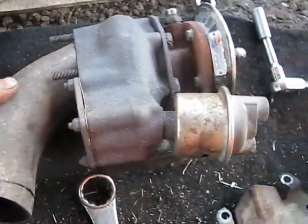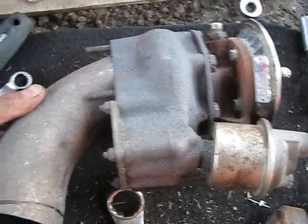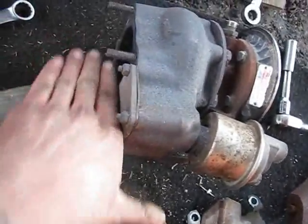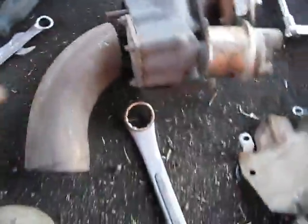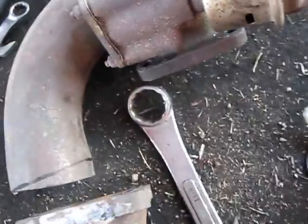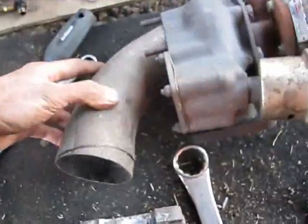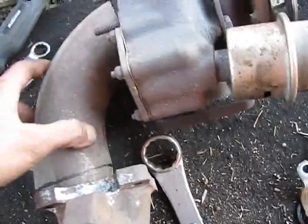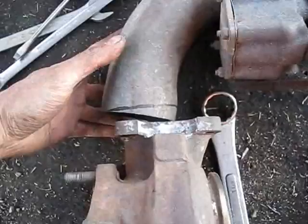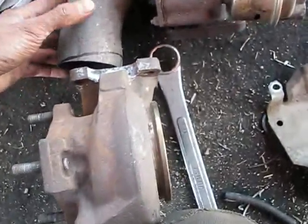What I'm planning on doing is running compounds. I really want to - this turbo is fine and dandy but it's not enough; you can never have too much power. So thinking coming off this one like that, and if space permits it'll have to come off at the same angle, straight up and down parallel to the turbo, and then this guy will go there. I'll just mock it up rough - something like that, except imagine this lifted up a bit.